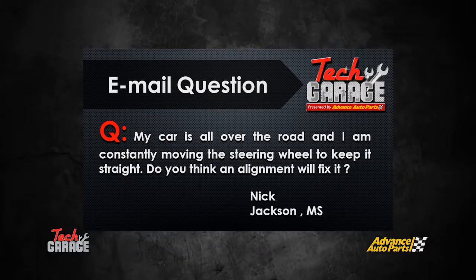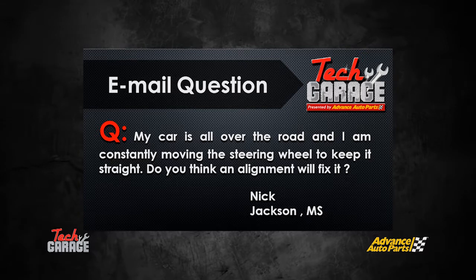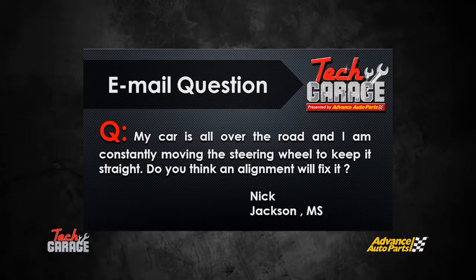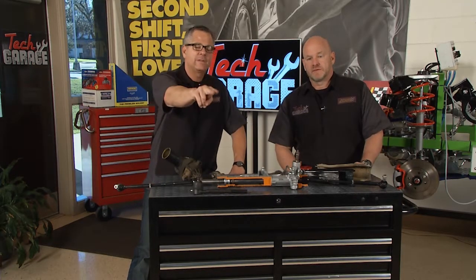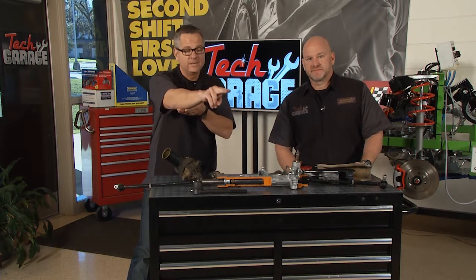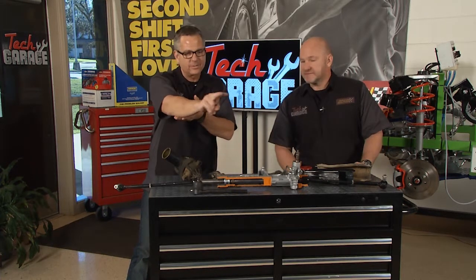John, Nick from Jackson, Mississippi emailed us, and he's got a car that he says is all over the road. He's constantly working the steering wheel to keep it driving straight. Do we think an alignment will fix it? It might, but you know, the first thing you want to do, Nick, is go out there, put 2 fingers and the weight of your arm on the steering wheel. If it's still pulling it out of your hand to the left or the right, it may need alignment, or there could be a couple other things.